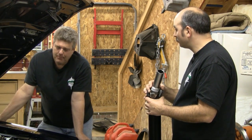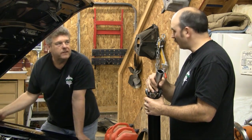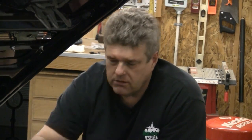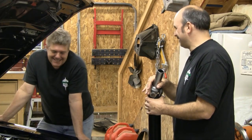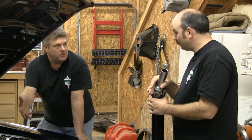I'm feeling a bit come-see-come-saw about the serpentine stuff. I put the serpentine system together thinking horsepower gains, but I got nothing out of it — so that's all myth. The only horsepower gain from something like this is if you use smaller pulleys, which gives about 5 to 10 horsepower, but it also causes your alternator to not charge as well. When I did the research, I found it's basically a maintenance thing. We're glad we did this and talked about the serpentine belt stuff today.